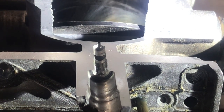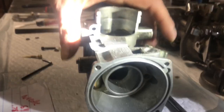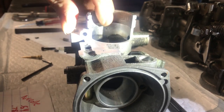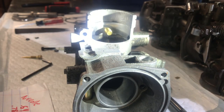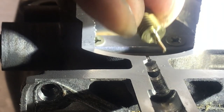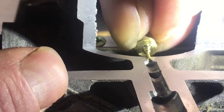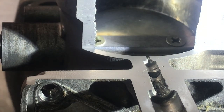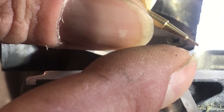From the second carburetor, the little hole is right there. I made a little needle and kept going further and further down until I got it to fit — that hole is actually 35 thousandths, which is 0.9 millimeter. If that burr wasn't there, my little tool should slip all the way through, but as you can see when I try to put it in, it bumps right into that burr. The pin on the needle is only 25 thousandths on the end and 30 thousandths up higher.